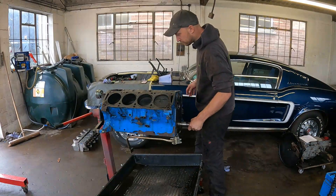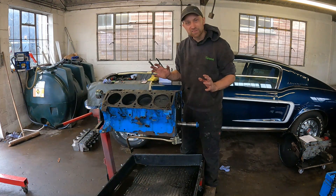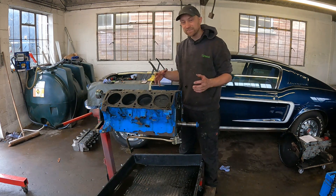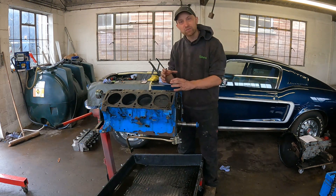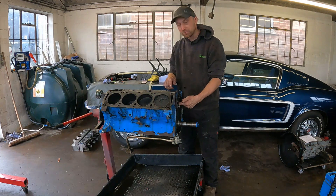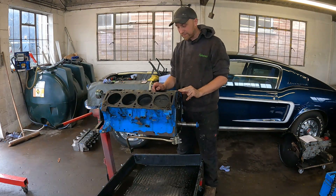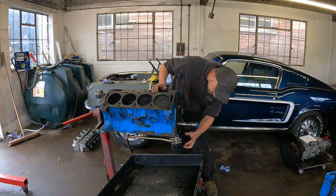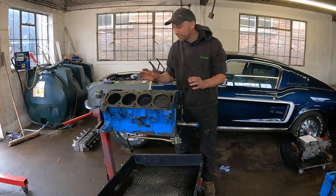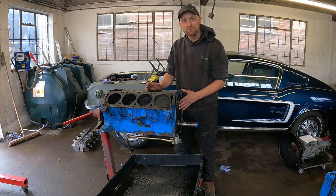It is just a whopper. It's been really cool working on one of these V8 American engines — I've not worked on anything like this before. And it always seems so strange just to have a single camshaft, only two valves per cylinder, which is exactly the setup the LSs still use. But it's just so simple — if it works, why change it? I've taken the distributor out a few times on this and I noticed there's a really long shaft in the bottom of it. It runs off the camshaft here — there's a little cog on the end which meshes with the distributor. But then there's a long bar that came out of the distributor and I was always a bit worried about it dropping down in there. But now I've got everything off I can see that it's the oil pump underneath and that shaft goes through the middle of the distributor all the way down and runs the oil pump as well. It's been really cool just finding out these kind of things — it's going to be nice and easy to put back together, nice and easy to time up. Just one crank, one cam — you can't get any easier than that.